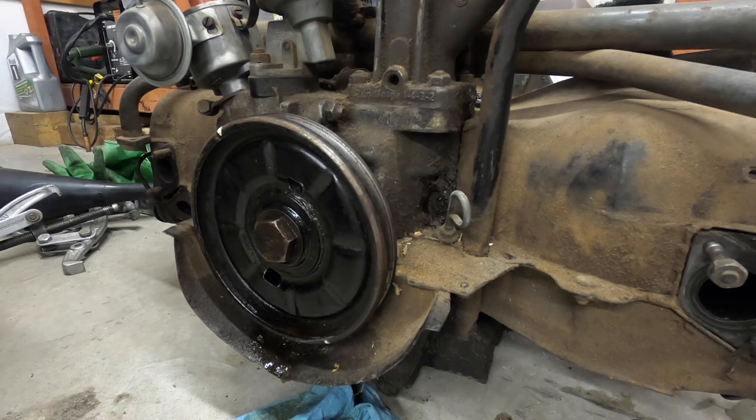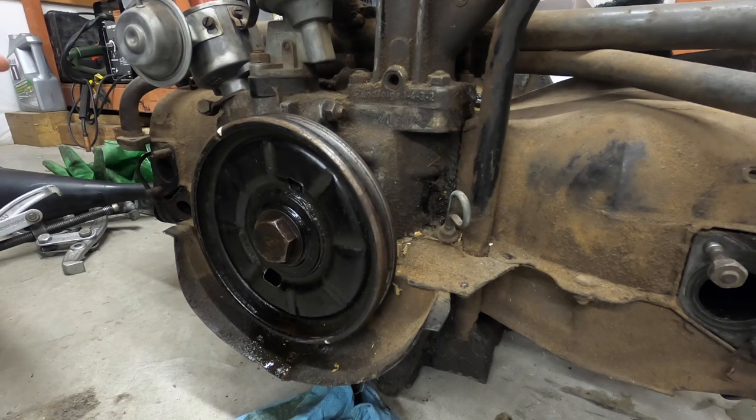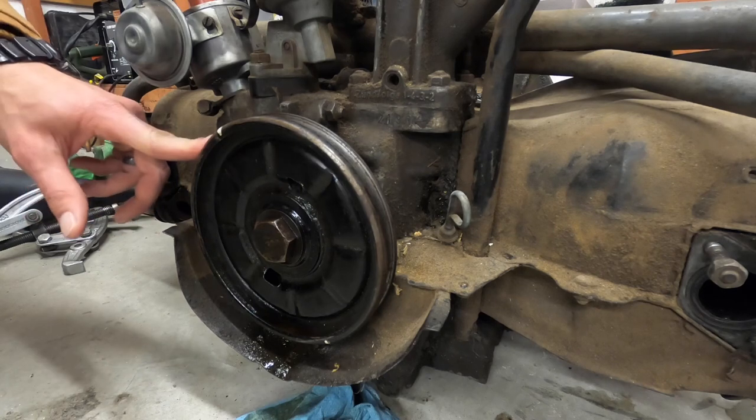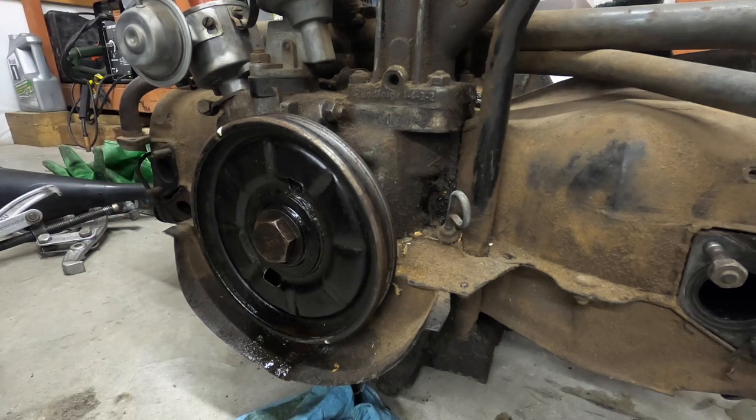If the engine's out and you have access to the flywheel, they sell a couple of flywheel locks — I'll put that in the description and post a picture here in a second — so you could do it that way. If it's installed in the car, you could try to have someone hold it with gloves, take that big wrench, and kind of try to knock it with a hammer on the top side of it, just gently. The flywheel locks — I would definitely buy two of them, because you risk breaking your case if you just have the one and put a lot of stress on it.